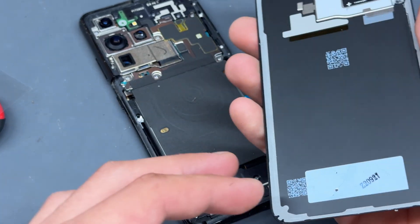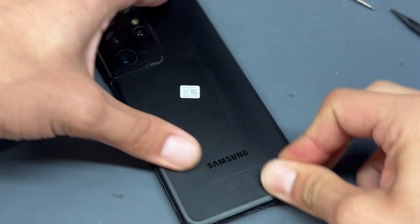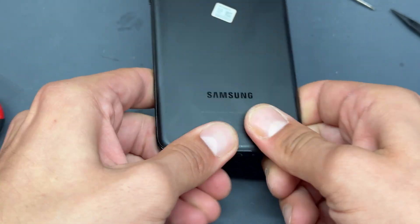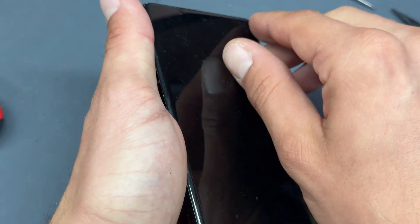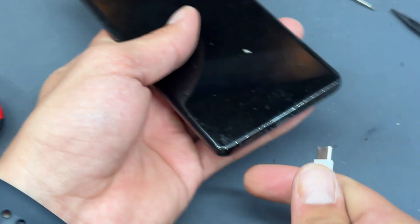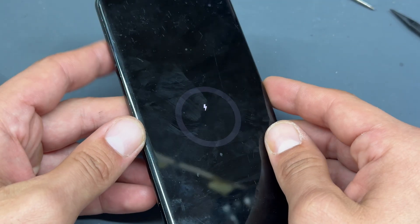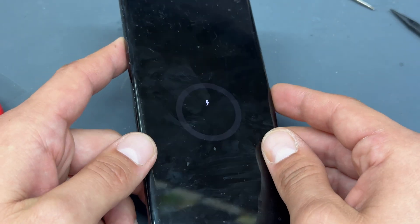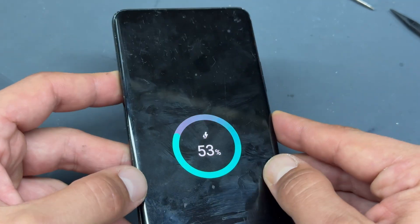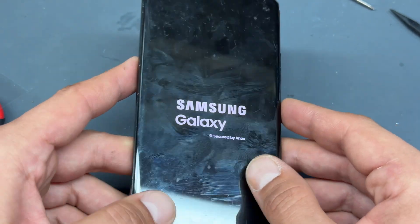With the old seal removed and the new one applied to our back cover, we're just going to lay it on top, push down on the edges, make sure that it's nice and tight. You can leave it on the heat mat to activate the adhesive for a little bit, but for the sake of the video I won't show that. What we will do is plug it in so I can show you that it's now charging. There we go — we've got the charging symbol. It's on 53%, but it's charging. Life is good again. That just about completes this video — thank you for watching and see you in the next one.